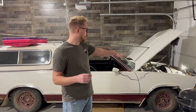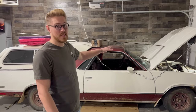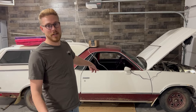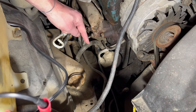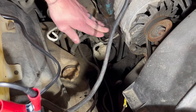We are going to take a look at the engine compartment, see if there's a good spot to put the fuel pump up there. We're also going to jack this thing up, take a look underneath it, and see where we can find the fuel line and a good spot to mount the fuel pump. One way we can mount our electric fuel pump is to splice it in here, possibly mount it to the frame rail, and then back over to the fuel line up to the carburetor.